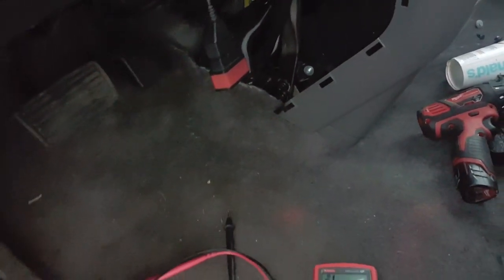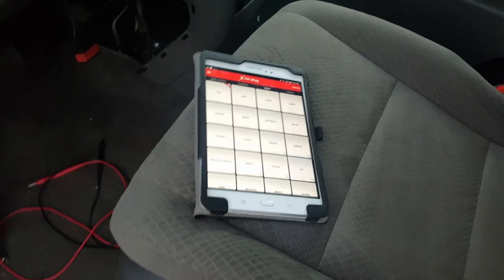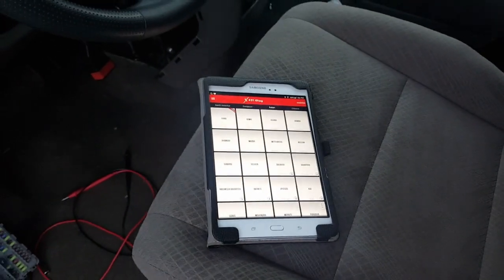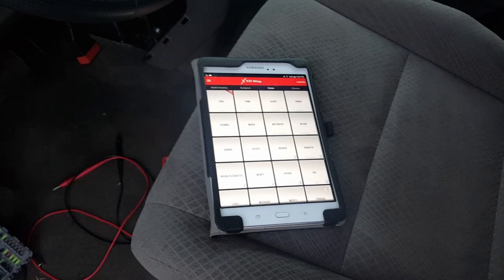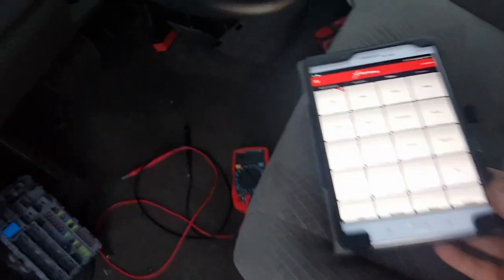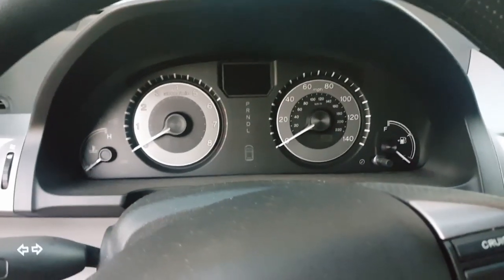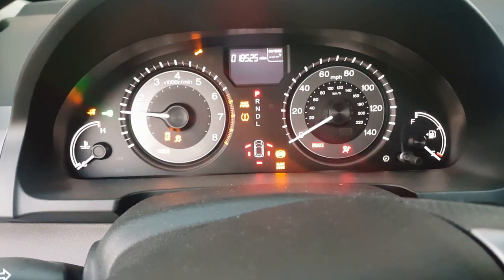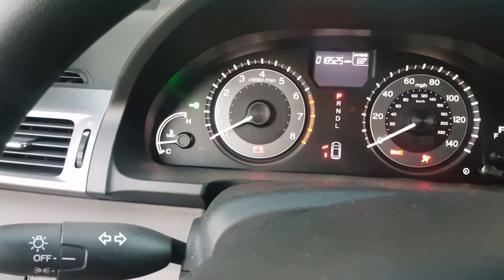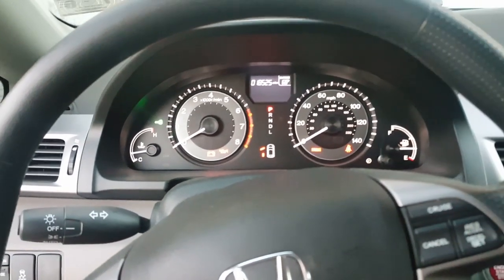I'm going to demonstrate that the vehicle will not start. You can see there's clearly no HDS here — I have skeptical people saying maybe I'm cutting out parts and using HDS to program. I will be honest: I am using this tool and I've been using it for a long time. So watch this — I'm going to start the car and you'll see a green key flashing. The vehicle started and died. As you can see, we have a green key flashing in that corner, telling us that we need to program the MICU unit.